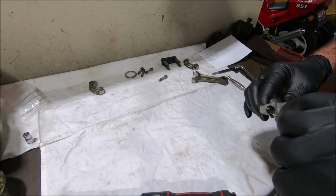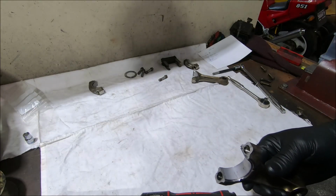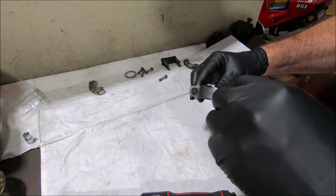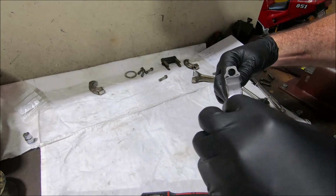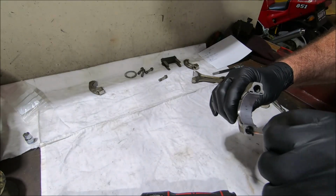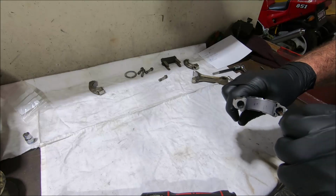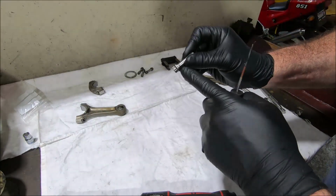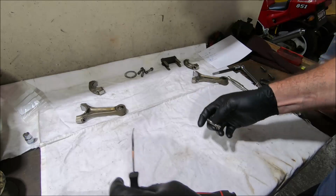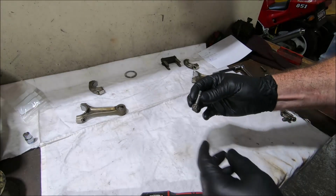And to stop grease coming off the bolts and into the parting line, I won't really put anything on the threads, maybe a little bit. We'll get the threads in here well greased. And then I put some grease or some oil under the head of the bolt, so that it has a nice lubed surface there as well. Might give the bolts a wash. They're brand new, but they're a bit sticky. So the bolts are washed.